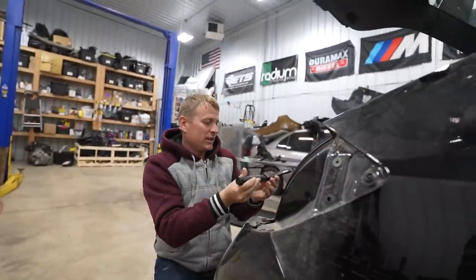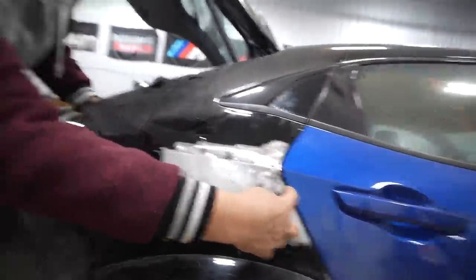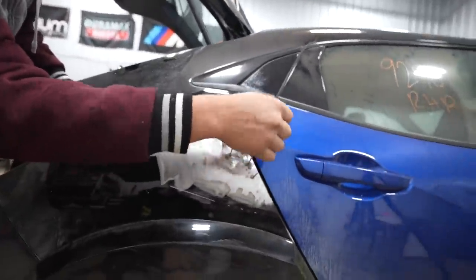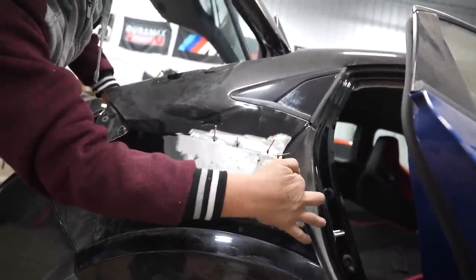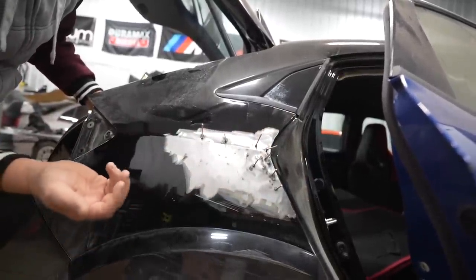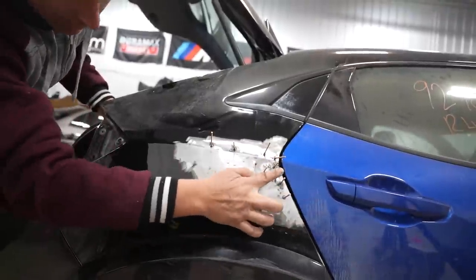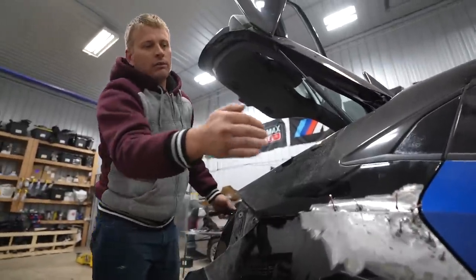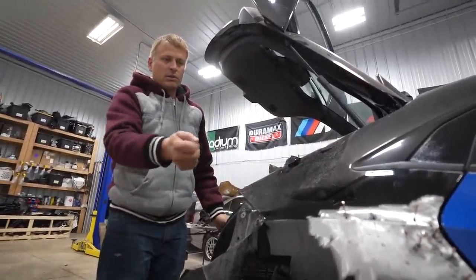So, basically, now in order to get this, we'll weld the plate. Like on the inside jam? Yes. So we're gonna put the plate inside here and weld it outside. Since we don't have this curve already, we're basically gonna be making our curve from the welds. It's pushed in half an inch, maybe 3/8. After the plate is welded here and pulled out, the rest of it is just gonna be hammering, tapping. Put hammering on my bumps I just made.